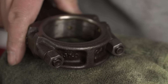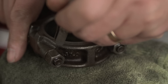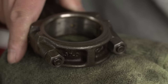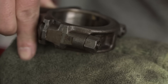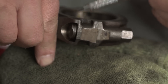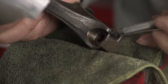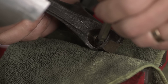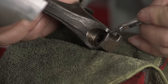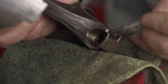On the cap side, this corner really isn't that bad — it's actually a curved corner, not a sharp one, even though the area is machined flat. We could round it over with a file but it's not too bad. To work on this we simply take off the rod bolts and use a die grinder on these corners. I've taken off the rod bolt and cap — this corner is what I want to round over. I do not want to gouge or take away material from the bearing surface; I just want to break this sharp corner.